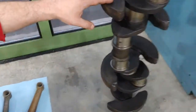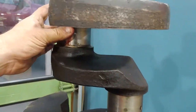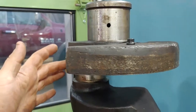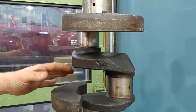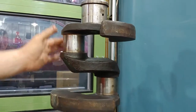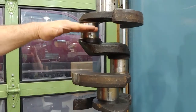If we look right here, you can see that this is the third crankshaft that arrived from Hankel yesterday. We have it out, it looks nice, we've measured it. We know dimensionally what our sizes are. Our rods would have been standard, would have been 2 and 3/4, and I think that the mains were 3 inches 250. I told Mike and Mark at Ohio Crankshaft, we're building a Babbitt engine, so it wouldn't be a big deal that they could grind until all the journals cleaned up nice and round, and we will do a custom bearing for the mains and a custom bearing for the rods. This crankshaft still has its counterweights on it. We've removed 22 pounds exactly off the counterweights, which will allow the stone to go in and grind those.